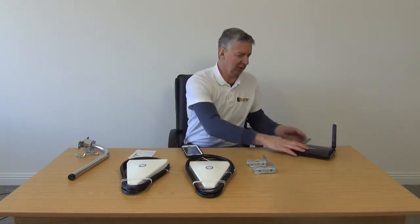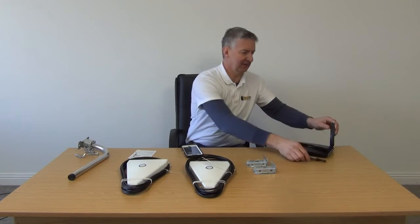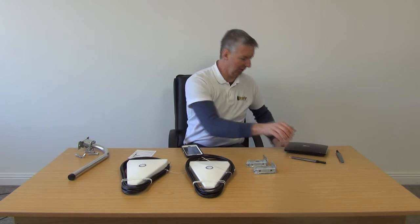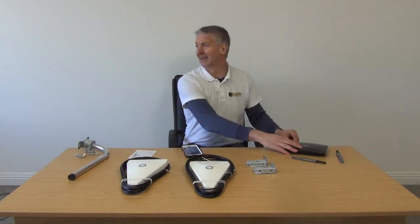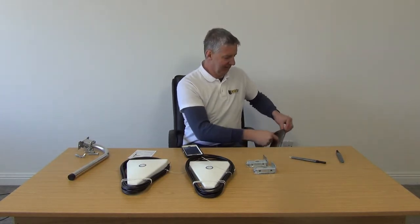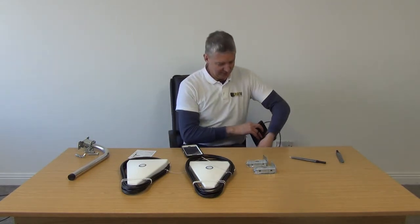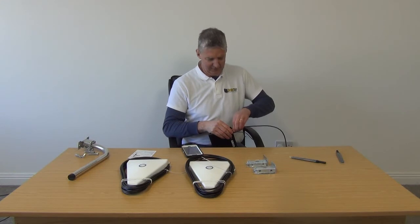What I'm going to do now is disconnect the small internal aerials — you can see here they have the SMA connections at the bottom. I'll hold one up so it's clear for people. Off camera I have our external aerials ready. I'm going to power off the router for a moment and reboot it to make sure it picks up the new signal. I'll screw the first cable in here — no particular order — then connect the second cable coming from the other aerial.